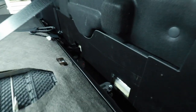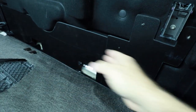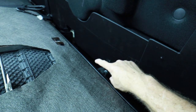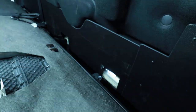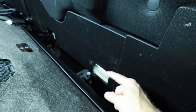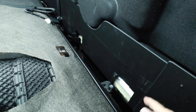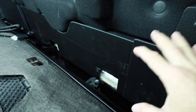That's what we've come up with for the amp board — hopefully that'll give us the length we need over there for the bigger amp. Made it a two-piece to accommodate the length. This will screw into the factory here and over there at the factory bolt. I'm thinking I'm going to make some kind of an L in the middle to hold the middle section. We've also made holes for the vents — this is important. These are for the window vent. People cover these things up, but I strongly recommend you leave at least one of them with access so that air can vent out of the car.